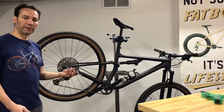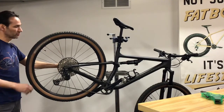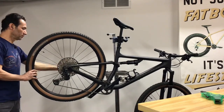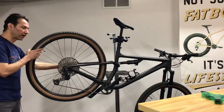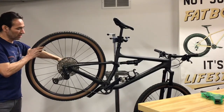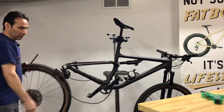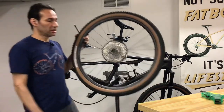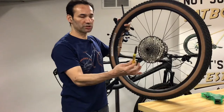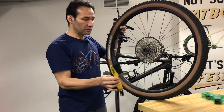I'm going to start preparing the bike before cleaning. First, let's remove the rear wheel — this should be quick and easy. Put all the parts in a place where you can find them; you don't want to lose little bolts or screws. This cassette can be cleaned without taking it apart — you can use a brush like this one to clean in between. Take your time.